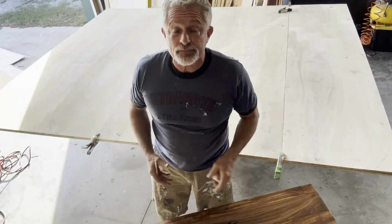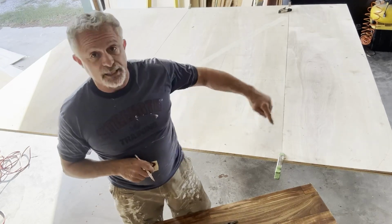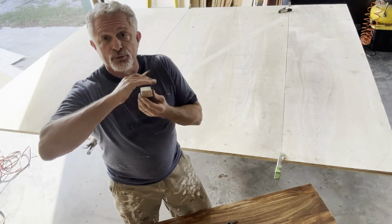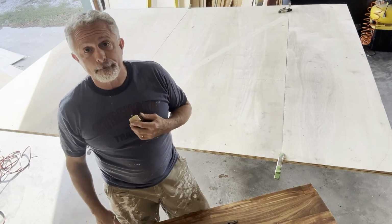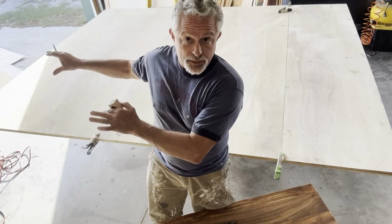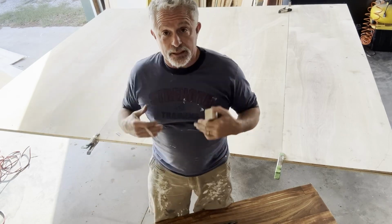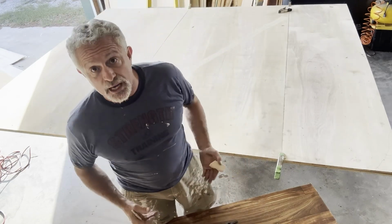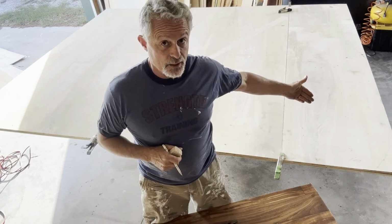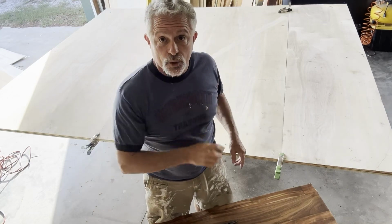Okay, I'm back. What I have to do now is take an inch off of that measurement because the roof rail goes across the top. It doesn't even matter what that was particularly because we're not reusing it, but I want it to be real close to that to keep the integrity of the design. So I've got to take 3/4 off this because the roof rail will go across that.